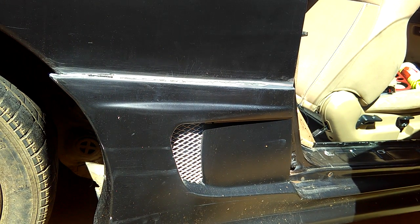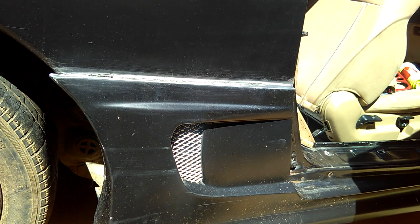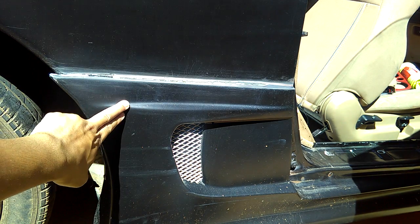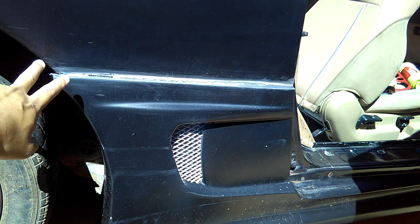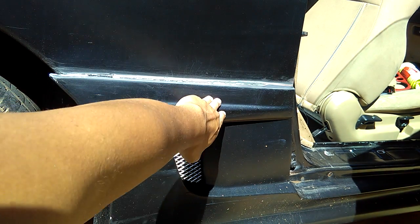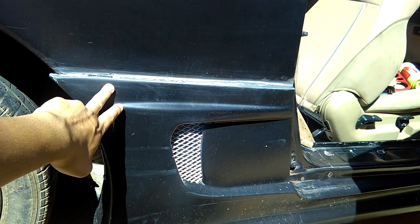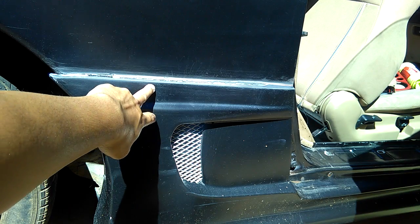This is probably video five or six showing you guys. Before I bond this crack area on my Eclipse side body kit, notice from the last few videos I installed gorilla double-sided tape and glue on the back of this body kit. It's been taped in and pushed — you need something like a board to push it down overnight so the adhesive will stick onto the body. If your crack is big, the tape might not attach to the body properly.